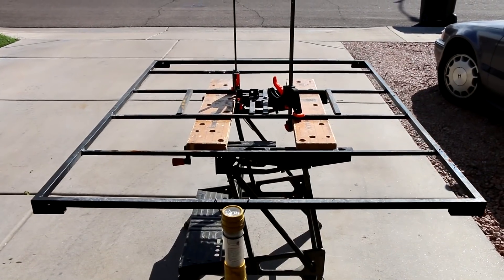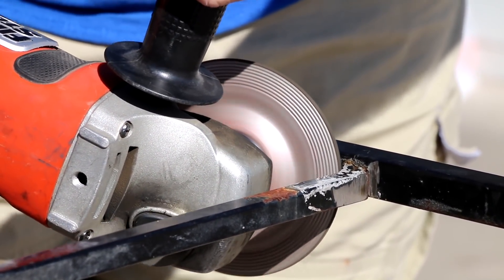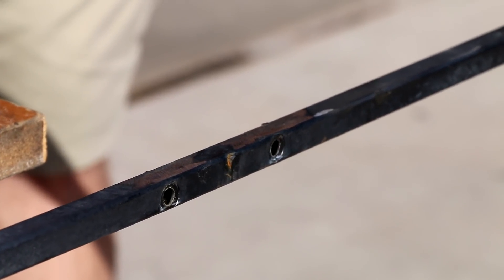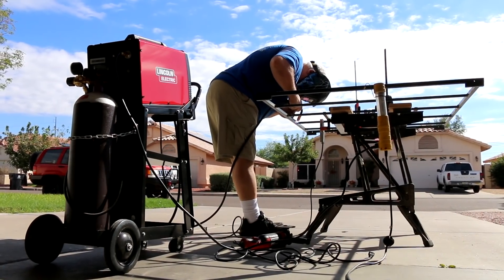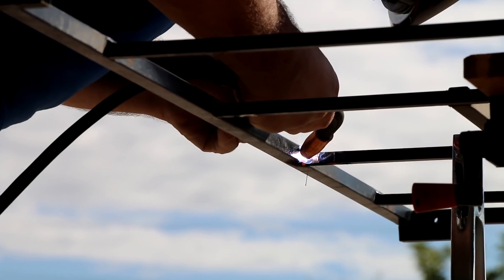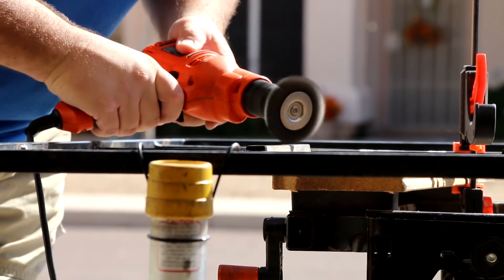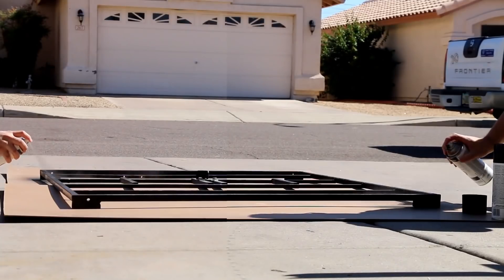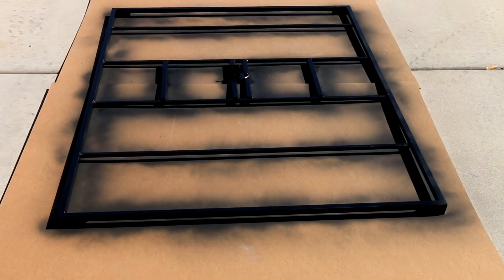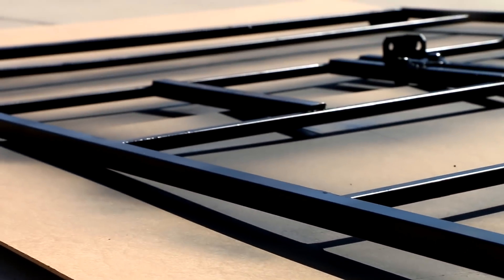After taking the roof rack off of the Jeep we set to work grinding down some of those rusty spots and some of the older welds on the rack. We also removed some of those old accessory mounts in the center of the rack by cutting them off with a grinder wheel — a fairly quick and easy process. After that it was time to re-weld the broken inner support and strengthen some of those older welds with new and better welding. After cleaning up the welds and the spots we had ground off, we let the rack sit and cool down before repainting it completely, making sure all bare metal and welds were well coated with flat black paint and then a coat of clear coat to help protect it from future wear and weather damage.